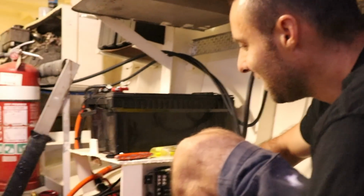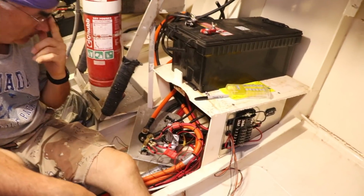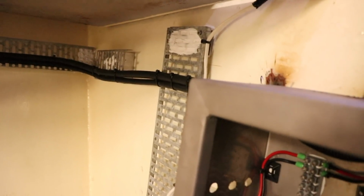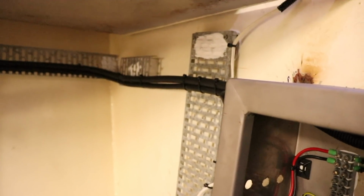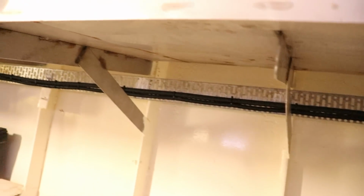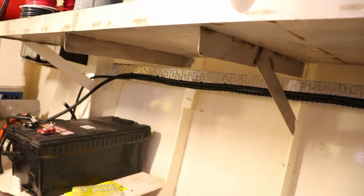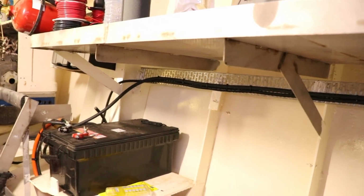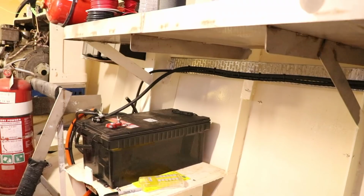Yeah, to the abyss. So, carrying on with the wiring, the AC is now strapped up nice and tight all the way around our cable trays. These cable trays come in 150mm, 100mm and 75mm widths, and we just use a really strong sealant adhesive to hold these onto alloy blocks, which are themselves held onto the steel. It saves a huge amount of time and gives a bit of vibration proofing if we do it that way.